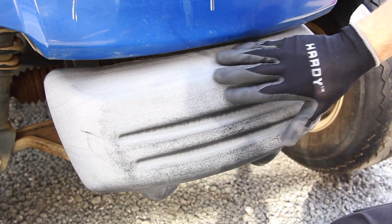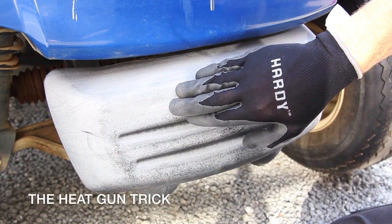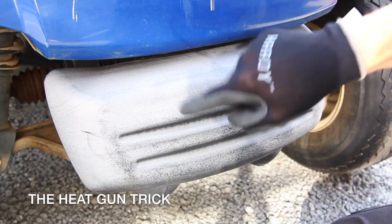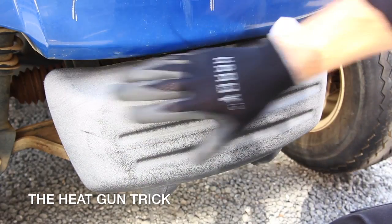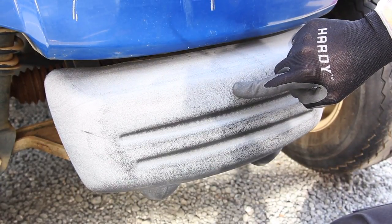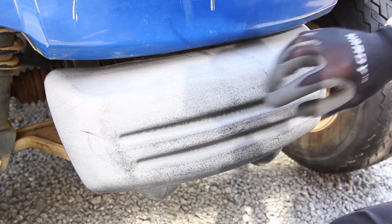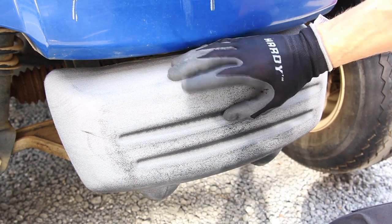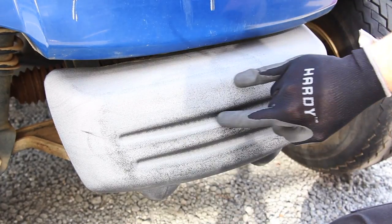Once your plastics have this level of fading and oxidation, the carbon black has been exhausted from the UV exposure — which is exactly why it's black. Carbon black in your tires and your trim work — they're black because carbon black is a competitive UV absorber. The UV rays hit it and disperse as heat. So this is exhausted; there is literally no pigment to enhance with the RenewProtect products currently as is.